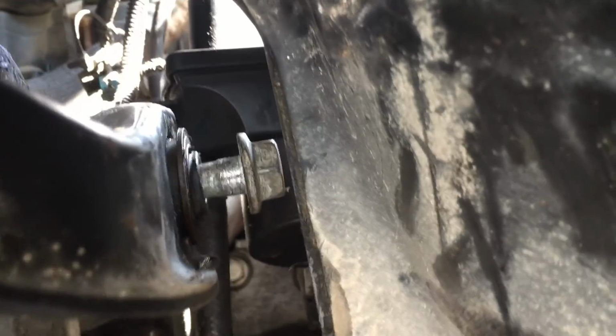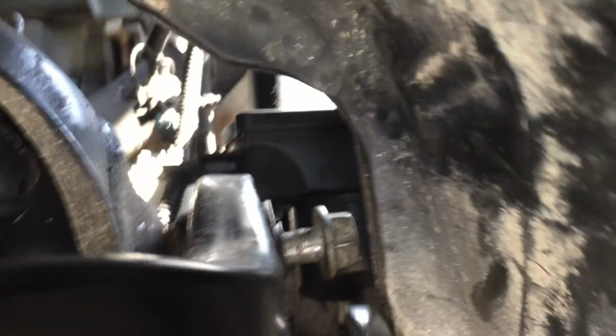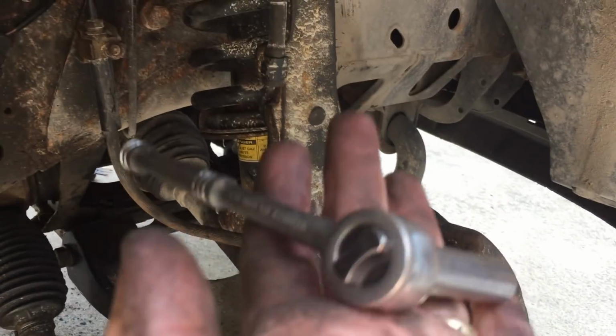And then once I got the bolts in, I kind of hand turned the bolt, and then I got a pair of these little pliers here and just got a hold of the bolt and spun it until the head of the bolt is past the inner fender well. Now I'll get my wrench on it and I'll tighten these down the rest of the way. Almost forgot that I put this spare jack I had underneath the front spindle here and lifted it up. Took some pressure off of the top so I could get the bolts in for the upper control arms.